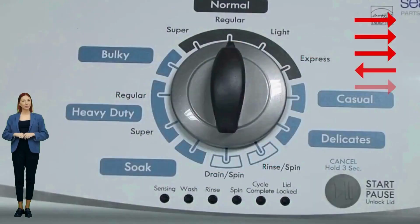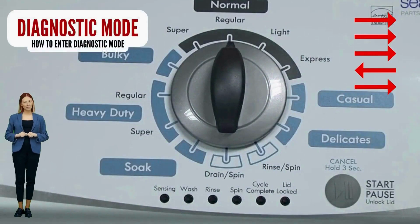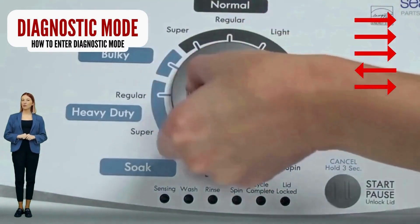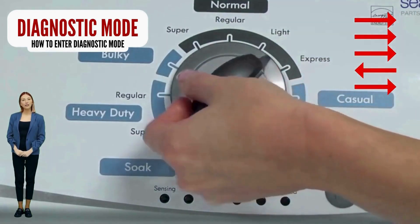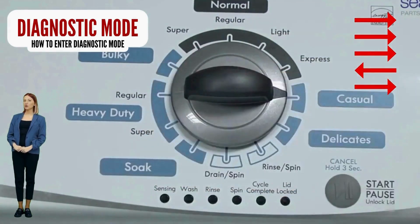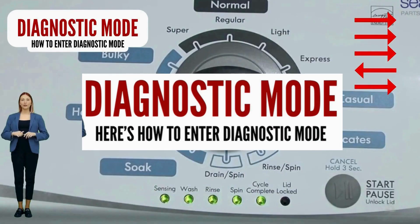You will have to re-enter diagnostic mode every time. From there, you choose what to do next by clicking the knob a certain amount of times. If your lights don't blink, try again, this time turning the knob faster or maybe slower. If it never works, your control board is no good — try replacing it. If your washer starts but doesn't finish the recalibration cycle, change your shift actuator and/or lid lock.